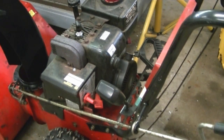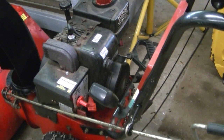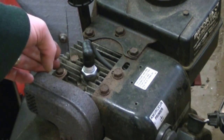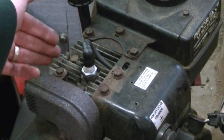My next question is about small Tecumseh motors on smaller snowblowers. This engine here is four horsepower, so I'm talking about four to five horsepower Tecumseh engines. People often email me saying they're really hard to start even after doing everything to the carburetor. If you've done everything — good carburetor, good spark — but the engine is still hard to start, what I often find with these smaller Tecumseh engines is that they get low compression over time. I have to take the engine apart, take the head off, take the exhaust valve and shave it down a bit so it will shut tight again. A leaking exhaust valve is what often causes low compression.